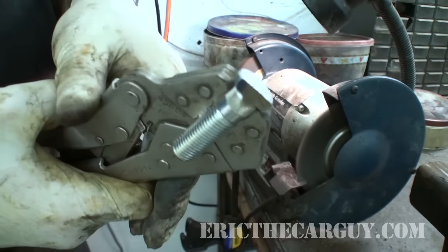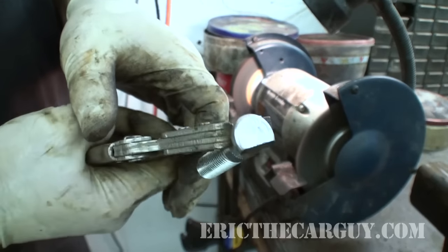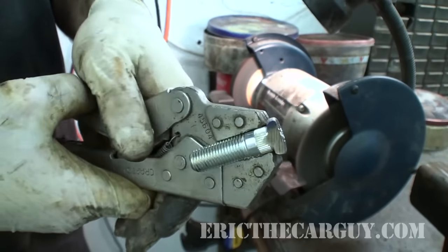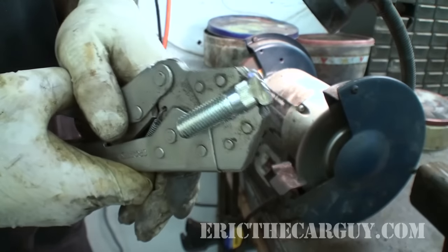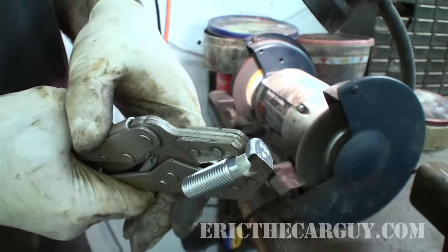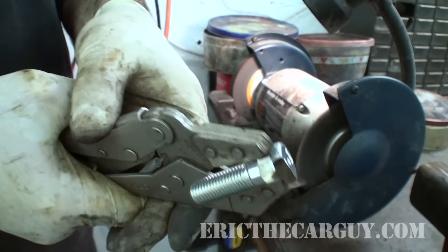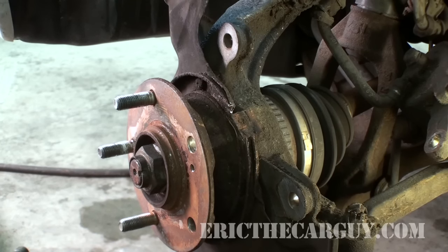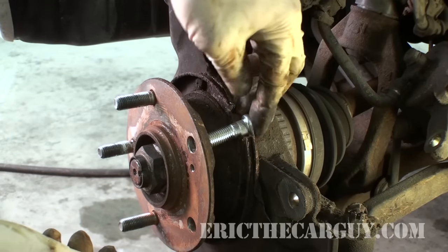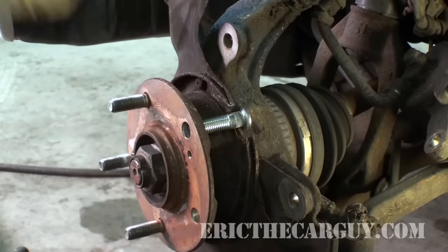Okay, here we have our finished product, and as I said some of you may have issue with this. I understand your concerns because it's not going to be held in like it would be normally if I'd removed the hub. But unless you want to remove the hub and possibly replace the wheel bearing, this is how you can do it. I'm hoping that the angle is enough that I'm actually able to slip the stud into place and get it to go in. Let's go over there and see if we can get this one in, and if we can, we can do the same with the other one. I've let my stud cool down a little bit and I believe we might just be able to make it.